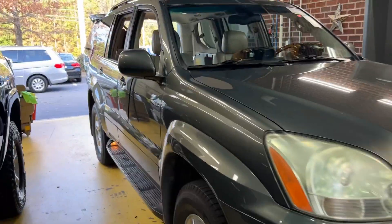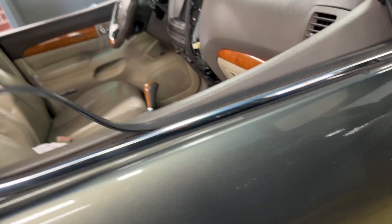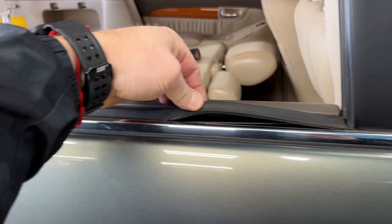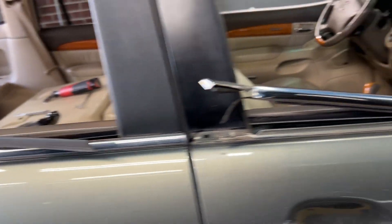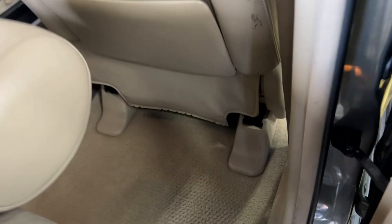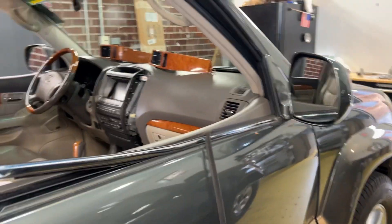Alright, Adam with Avalon Auto. We're going to do a quick one on belt moldings. On about 80% of the GX's I get, the belt moldings will separate and start to come apart — the other side was pretty much hanging off too. There are torx screws on the front door and one on the back door, I think it's a T15 or T10. This one's an '06 with 225,000 on it, so it needed some persuasion.